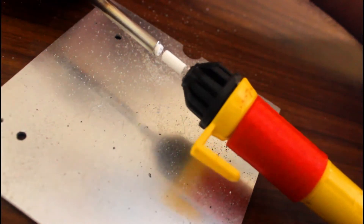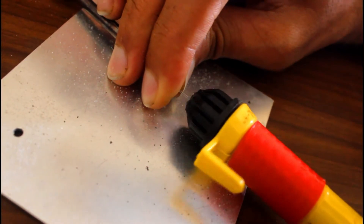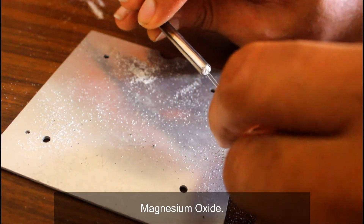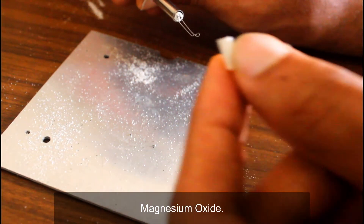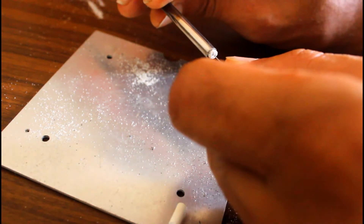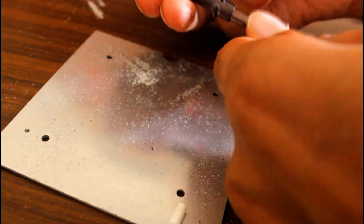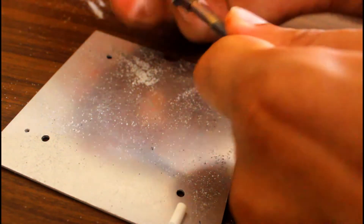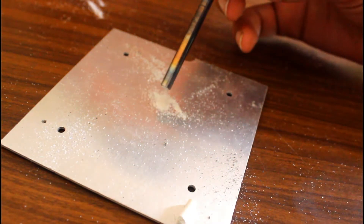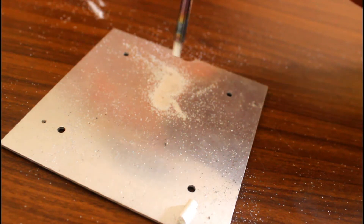Here I was talking about the grains spread out here. It looks like table salt, but it's not. It's actually magnesium oxide. Even the white thing we see here is also magnesium oxide. It has high thermal and low electrical conductivity, and is chemically stable even at high temperatures. This is the reason it's used inside these heating coils.